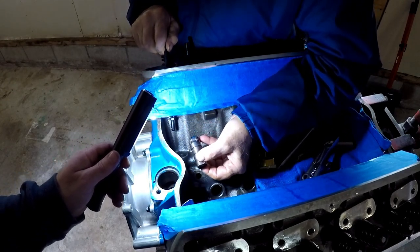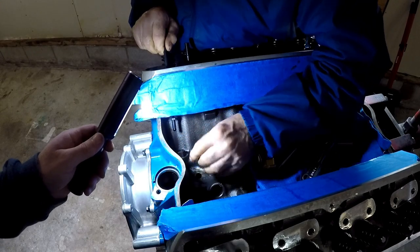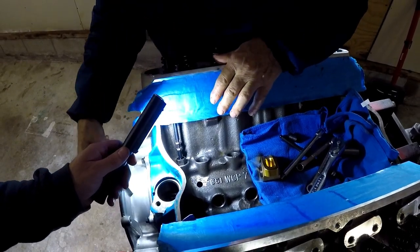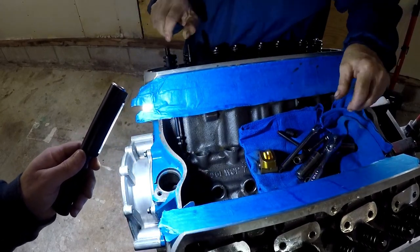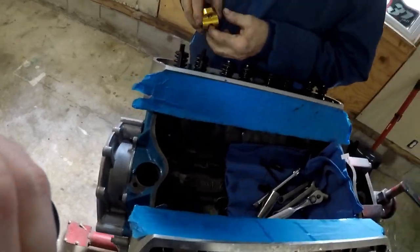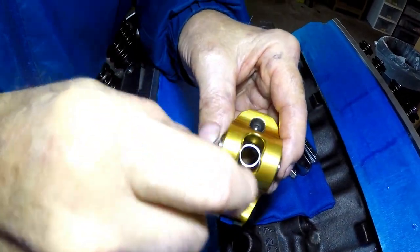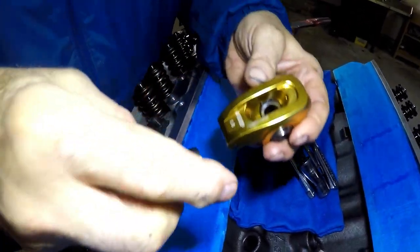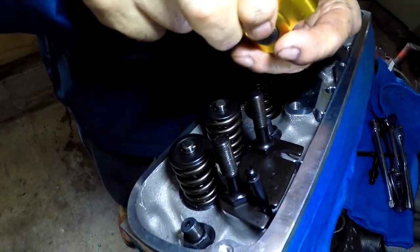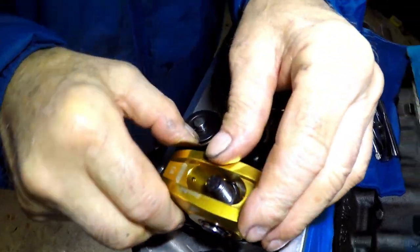So then you put this in so the roller lines up on the cam where the flats are parallel, like this. So the roller is right on the cam right there. Now we don't know what the position is because we don't have a damper, but we're going to rotate it. And you put the two stud deals on here. Then you put the rocker on. The rocker has a flat spot in here and another one over here, but for the nut to work right it's got to be here — this has to be up. So this goes on like so. When you get the right clearance, you use the Allen wrench to lock it down, but we'll go through that later. We're just trying to get the right length for the push rod.